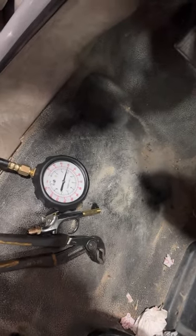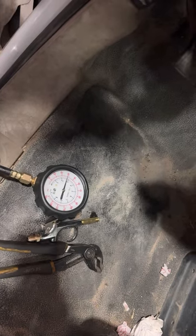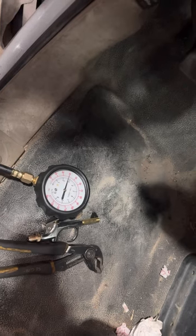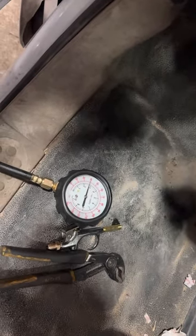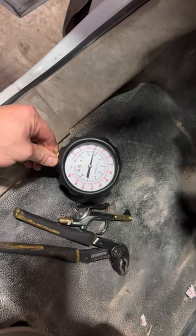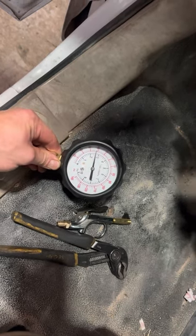So basically, one of the ways to go about it, and I looked around, they wanted you to get a pressurized kit and all that. So what I did is I have my oil pressure gauge here, and this is hooked up to the 1/8 MPT port next to the oil filter to test my oil pressure.